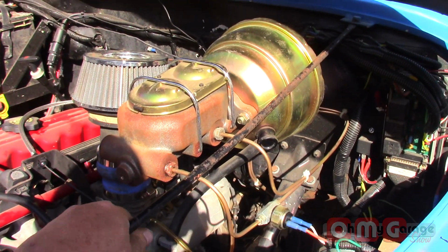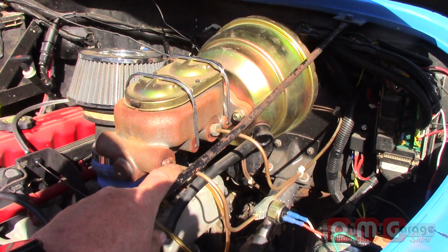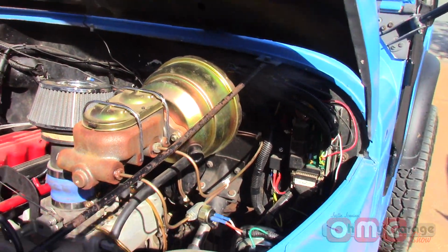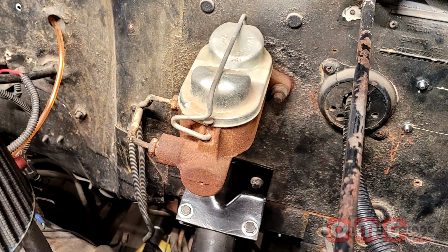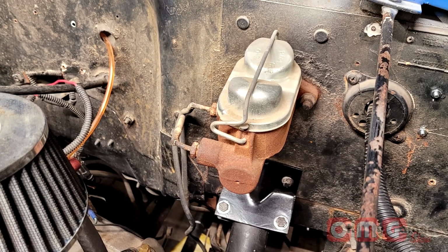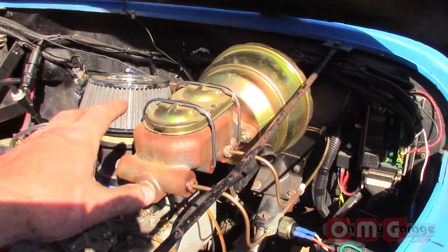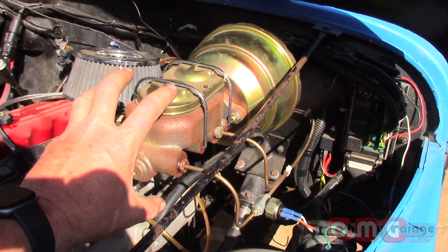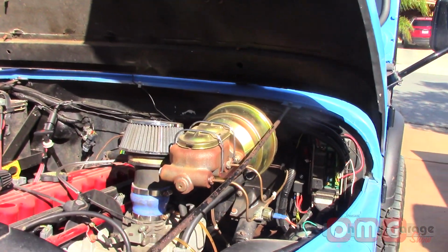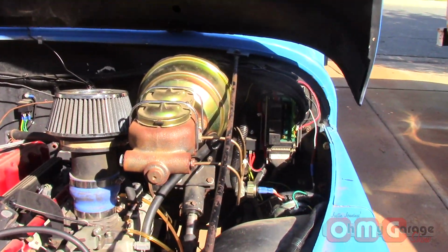It's got disc brakes. You really need to have a power booster on the disc brakes. The master cylinder that was on it was just the old factory style 74 brake master, and man, this thing is really big and comes way out compared to what was there. But I don't know how else I'd power those disc brakes very well, so that was an upgrade.